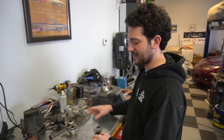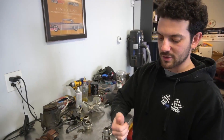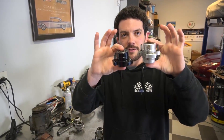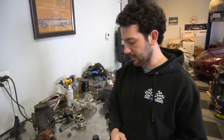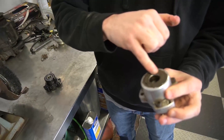So here are our old hubs and bearings. Here's the tricky thing — we have our new bearings from Go Power Sports, and we can just rob these bearings out of these new hubs, because the hubs are different heights and we don't have to worry about buying spacers. Problem is, one of the spindles is a larger diameter — it's tapered. So we have one bearing that's larger that we don't have. So we're going to knock it out and try to find a part number.